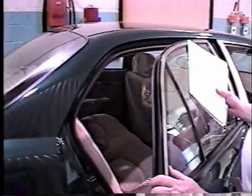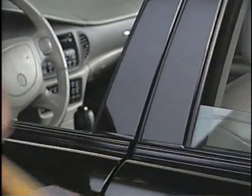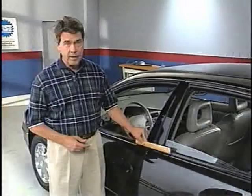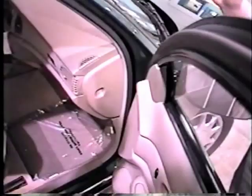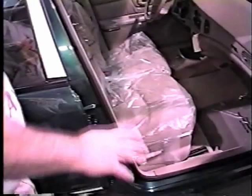No, other than the striker. It's unlikely, but if you run into a fit discrepancy at the front door, for instance, if the molding doesn't fit flush against the A-pillar, remove the front lock striker. Then check door alignment with a straight edge here. The front hinge can be adjusted to correct alignment. Just move it maybe a mil at a time, then tighten it up and close it again. You generally use a straight edge here. And then adjust your striker to whatever you need.